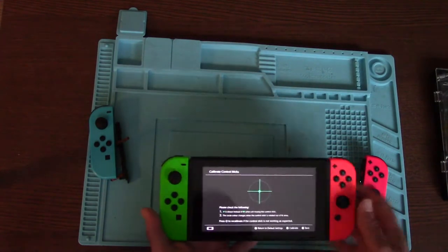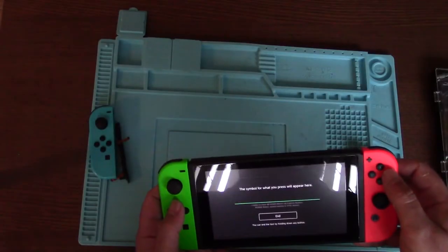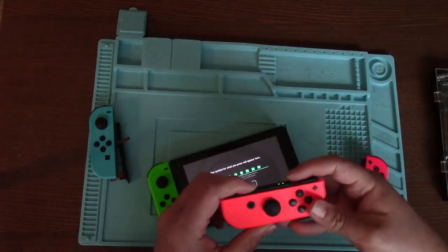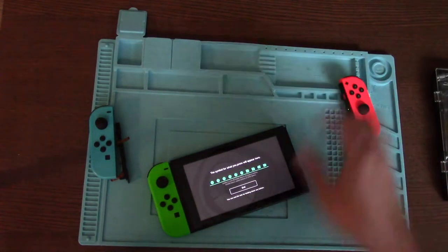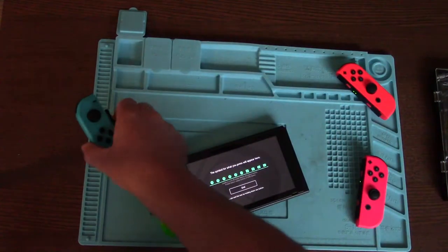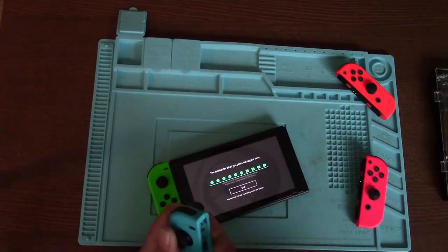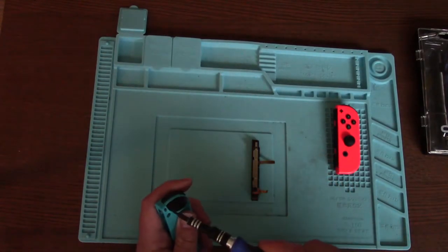That wasn't mine, so that'll be fine. Obviously I can't check this one until I've tried to put it back together. They all seem fine. All I need to worry about on this is the thumbstick, and on this one I'm going to try and see if I can get this back in, then see if we can look at replacing the release button and the thumbstick. We've got a size 2 tri-wing screwdriver - just undo these screws.